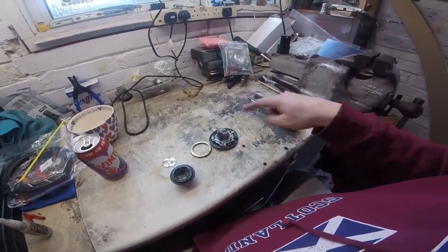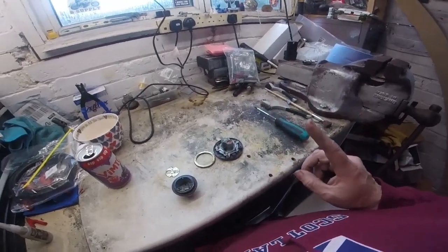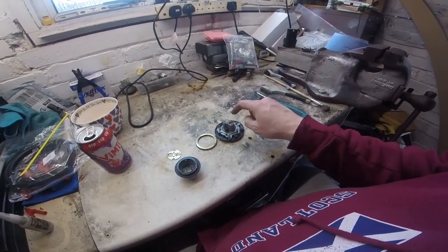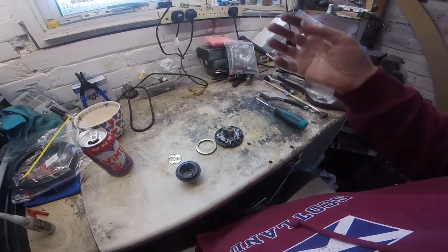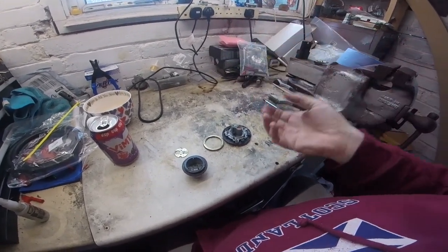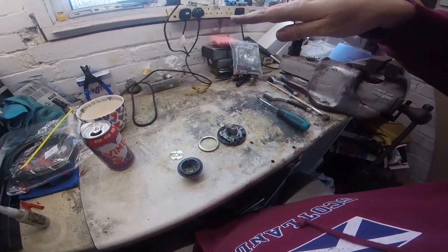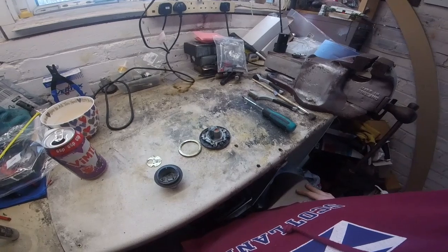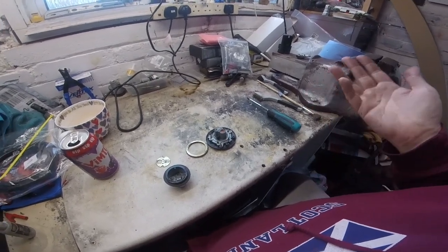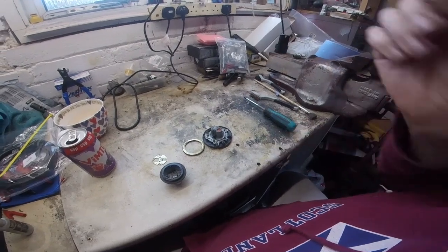And it's usually almost 187 million percent of the time the vent, because obviously as the fluid level tries to lower, it has to suck air in to replace it, and if it can't suck air in, it hangs the level, so basically it overcomes the gravity. So, Jim, stop it, just strip it, just clean it.